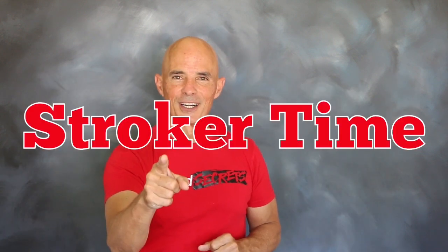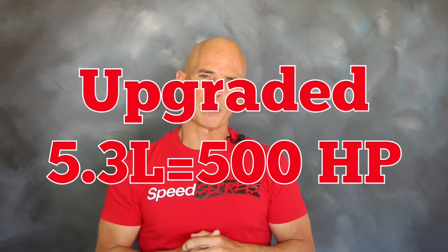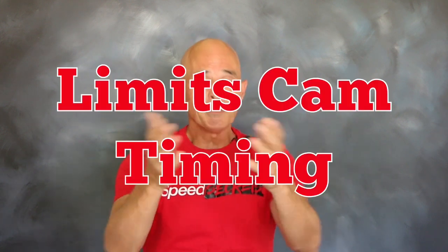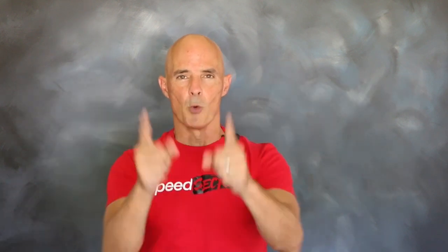Now that's a good start, but rather than installing heads, cam, or maybe a fast intake, we decided to go all in and build a stroker. You might be asking yourself why not just install heads, cam, and intake on our 5.3 liter? Well, if we install ported heads, a Comp cam, and a Fast intake on our 5.3 liter, we're going to produce somewhere near 500 horsepower. But that factory short block doesn't have valve reliefs, so it limits the amount of camshaft we can run. If we build a 383, we get more displacement, but we also get a piston with a valve relief that allows us to run even wilder cam timing. So the combination of extra displacement and wilder cam timing equals more power.